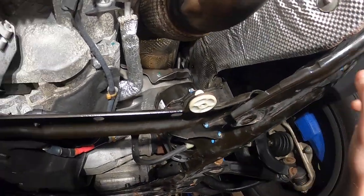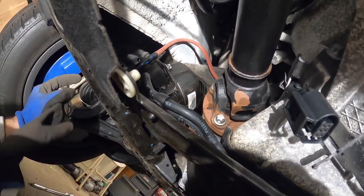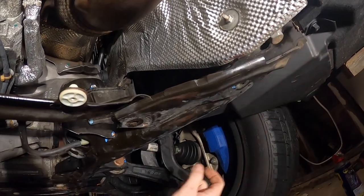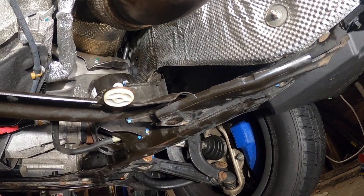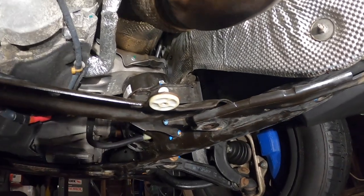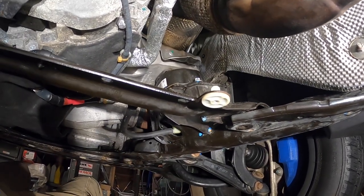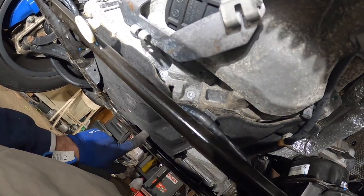We have to loosen the subframe. So I'm gonna loosen bolts, 3 bolts on this side, so they're kind of like a couple turns out, and basically drop this side, take this bolt out all the way, and the other 2 just loosen, so they may be holding on 1/4 of an inch by threads, so the subframe does not drop on you, on yourself or on myself for that matter. Yeah, because this is pretty heavy, and we have to support the engine with a jack. Like, you could support it right here, that's a good spot.